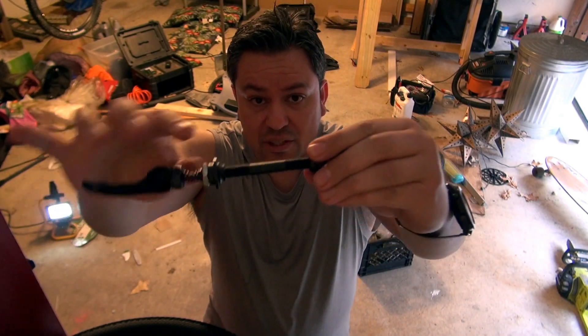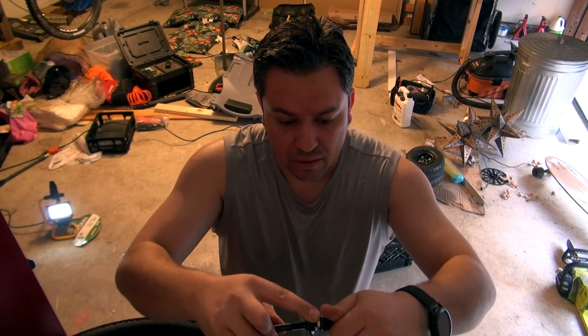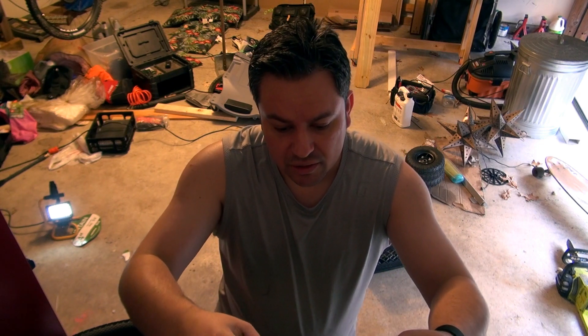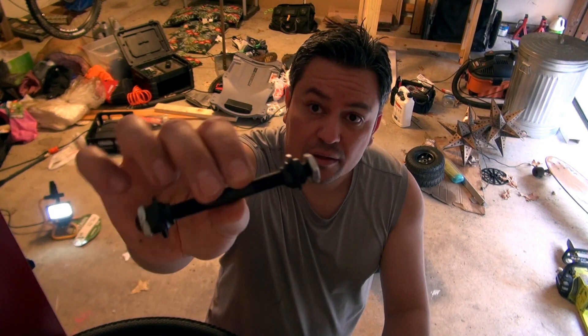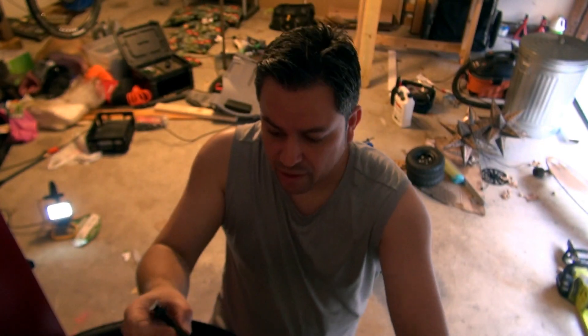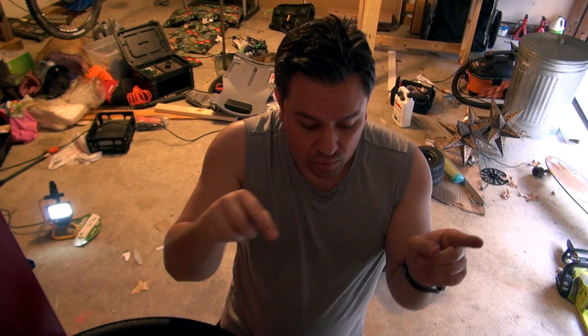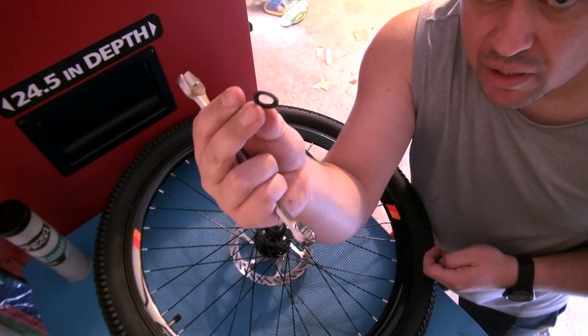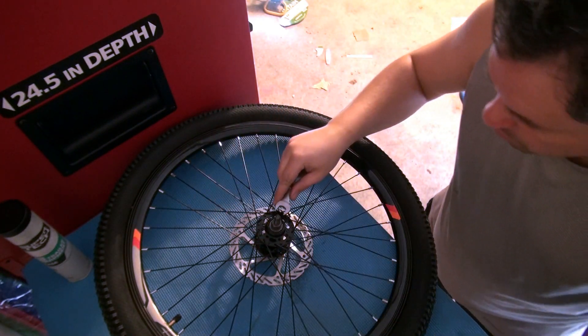Here's what the quick release looks like — it's just like any other quick release, and it's actually a stud that has a hole that takes the skewer. So all we have to do is replace the existing stud with this quick release stud and we should be all set. We're gonna reuse the alignment piece to keep the wheel aligned until we upgrade to another fork.